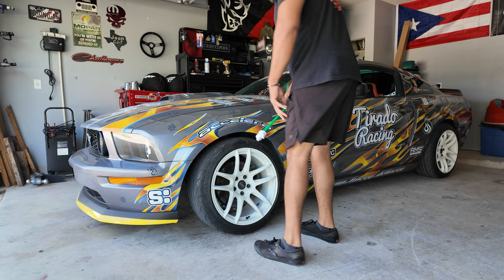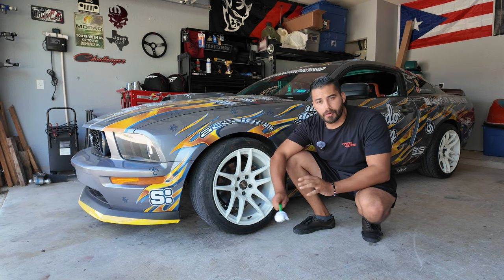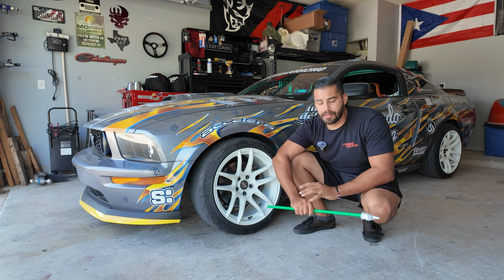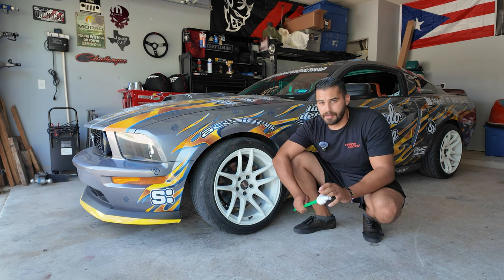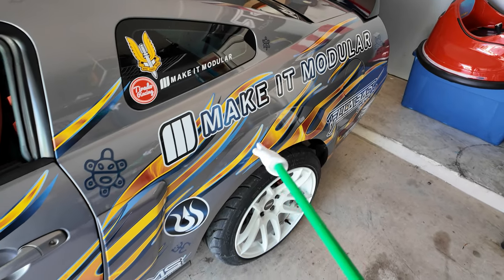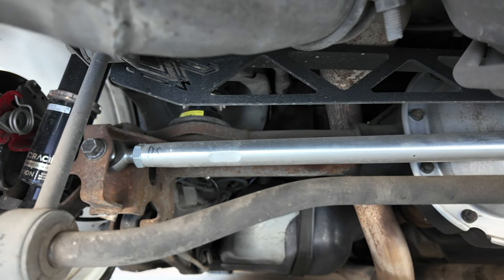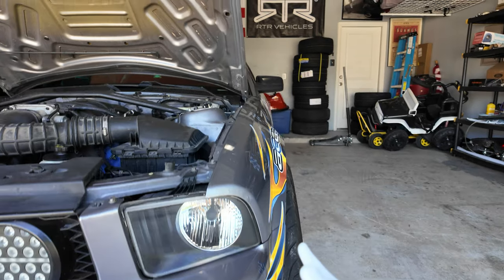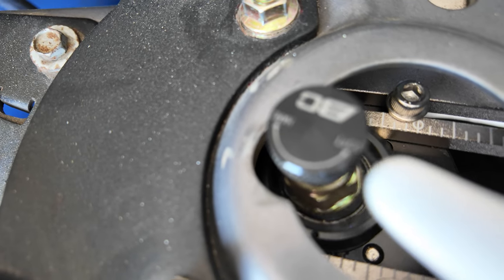Let's talk suspension — the car is lowered on a custom-spec set of BC Racing coilovers, custom made for my car and specced out by Davey Peoples over at BC Racing. Contact them for the best coilovers for your drift car — I've added their info below. Once you lower a straight-axle Mustang, the axle is going to shift left or right, so I got a Scotty D panhard brace and adjustable panhard bar to re-center the rear axle. I kept the factory rear sway bar but removed the front sway bar completely.